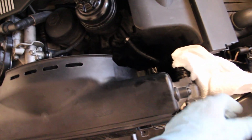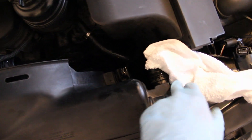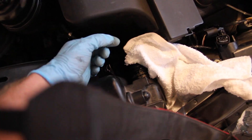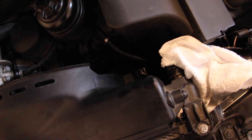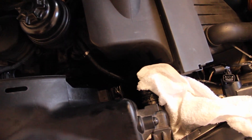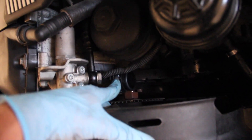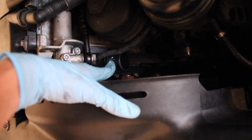We went ahead and removed the radiator hose out of the top right of the radiator. It's got a little metal clip — just get a flat blade under that, pull it up, and wiggle it out. You're going to lose some coolant, so get some shop towels. The other end of that goes in around the water pump area — same deal. You've got a metal tab, use a screwdriver, pop that hose off.